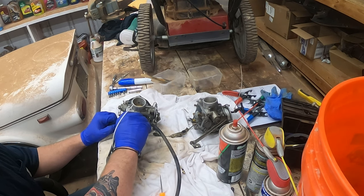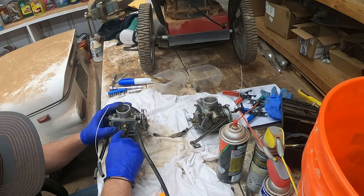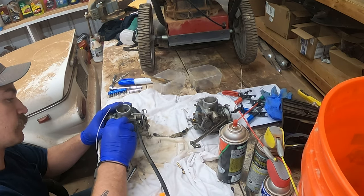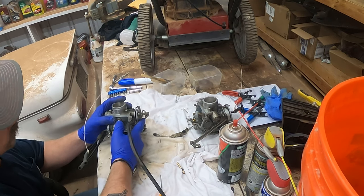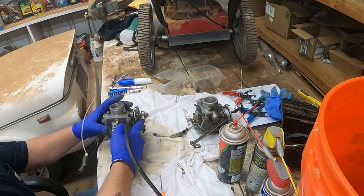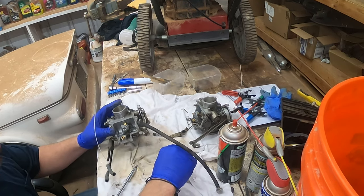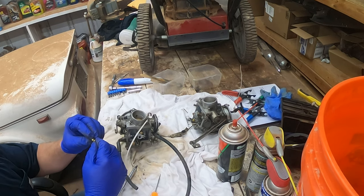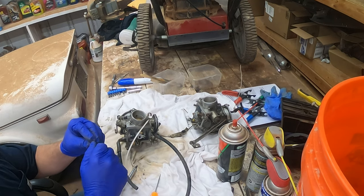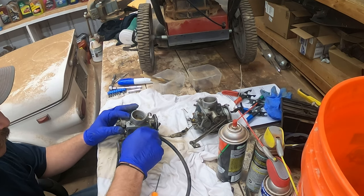Personally, that is one of the main things I use. I even carry a wire brush in my tool bag just for that purpose so I can steal bristles off it to clean jets. I have not had one enlarge the diameter of the hole in the jet to the point where it messed up the air-fuel mixture ratio. But it's something Honda mentioned in big bold letters in one of their service manuals, so I decided to tell y'all.